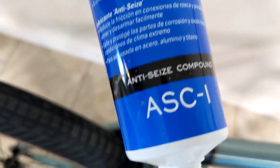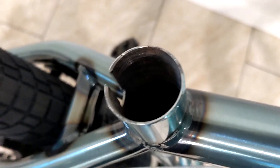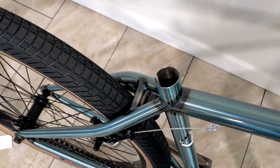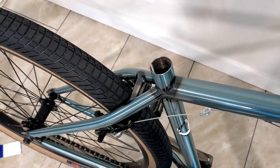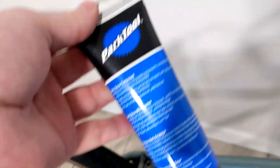One more quick tip: Park Tool anti-seize compound. If you have a steel bike and an aluminum seat post, aluminum will create aluminum oxide over years — little burrs that grow like tiny spikes on the outside of the aluminum — and they can get seized in there. Just YouTube 'stuck seat post' if you want to see the nightmare some people go through. It happened to me on a DK bike — the seat post was completely stuck. So just use this like grease, put it on the seat post.